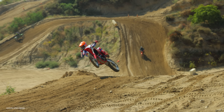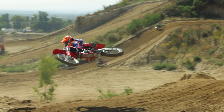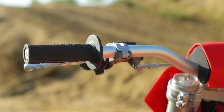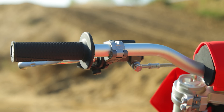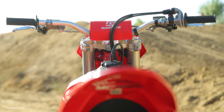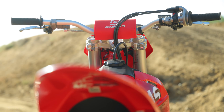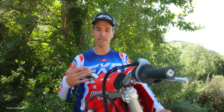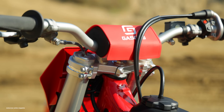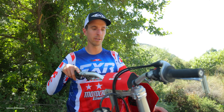Other changes: no map switch. That is consistent with GasGas for the last few years — they've tried to make this the more affordable platform, and because of that, they leave the map switch off. This bike is stuck in map one; you don't have access to the green map. It is plugged into the ECU though, so if you spend about $100 at your dealer on a map switch, you will have access to traction control, map one and map two, and quick shift.